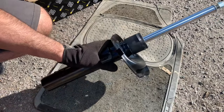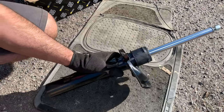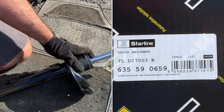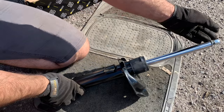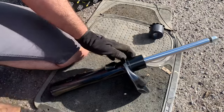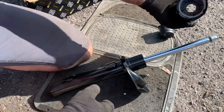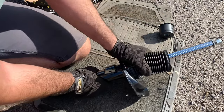These shock absorbers are from Starline — a brand I've used on other previous suspension components and I've been quite happy with. They've been very good so far, so I thought I'd give the shock absorbers a try. They cost just over £100 on Eurocar Parts and I'll put the part numbers on screen and in the video description. They came clamped, and I'm going to remove this plastic collar and use the actual original Ford one instead — it's still in good shape. I gave it a clean with some degreaser, and it will go in all the way to the bottom.